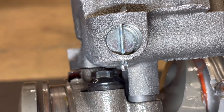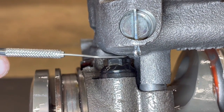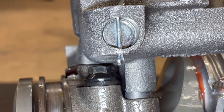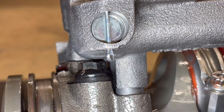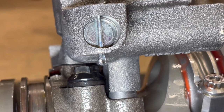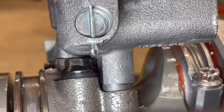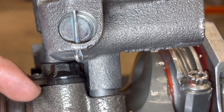We went to see if it'll fit, but the one thing you notice is the actual head of the bolt is hitting right there on that oil pump piece. So what we need to do is remove some more material from where John is pointing to get past that bolt head. Also looking at the ARP instructions, sometimes it does call for not having that washer. I would like to have that washer, but if it's something we can't use then we're going to have to take that out. But I'm pretty confident what we've clearanced on the side is working — what we're going to have to do now is check to see how much we need to take off the actual pump there to clear that head bolt. If it still doesn't work, then we will take that washer out.